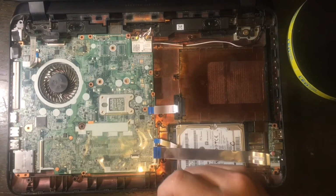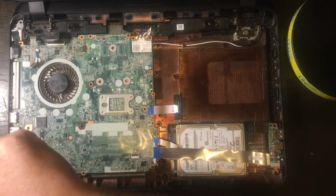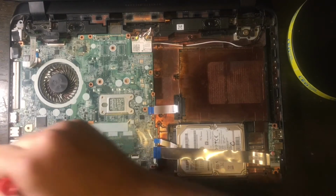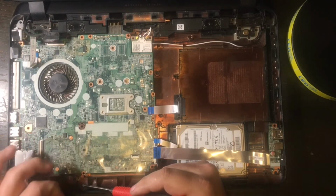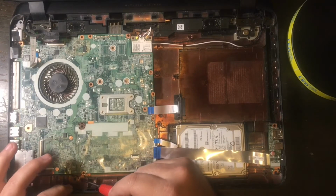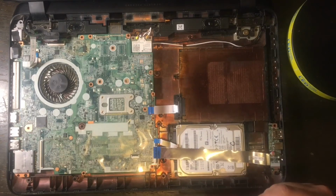If you're ever inside of a laptop and you get confused, in a modern day laptop, usually the holes you need to put screws into will have a white triangle mark. Not always the case, but a lot of the times. So in this laptop, there's going to be 4 if you count the Wi-Fi card, the way I took it out in this video. And again, don't be discouraged in doing this. This is not like building a spaceship, or you don't have to work at NASA to do this.